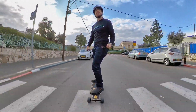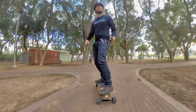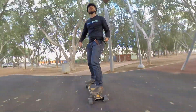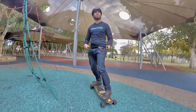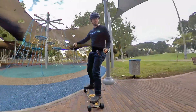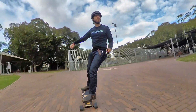That might be overkill for some, but it would turn this thing into a serious hill climber or a nice off-road board if you swap on some off-road wheels. As it is, the kit is plenty powerful with just the two motors. I don't have any huge hills around here, but it climbs smaller hills just fine. When it comes to batteries, you get the choice of either a 144 watt hour or 216 watt hour pack. They can give you between 8 to 14 miles or about 13 to 23 kilometers of range, depending on the pack and how hard you ride. If you spend a lot of time near the board's top speed of 28 miles per hour or 45 kilometers per hour, that range will drop a bit.